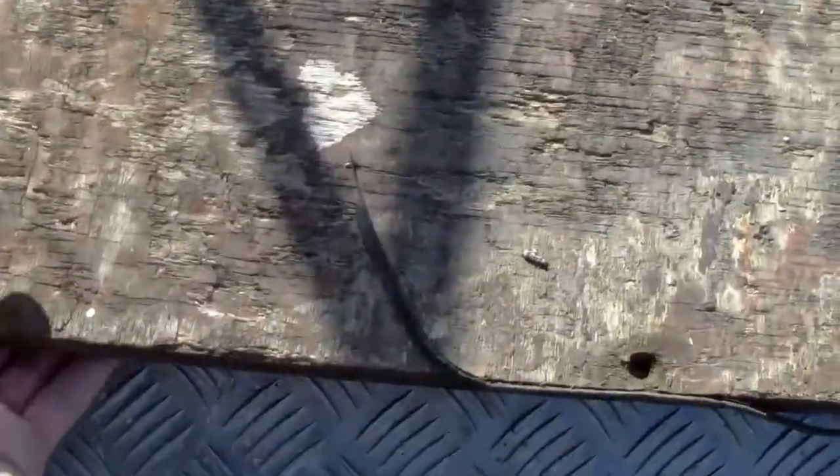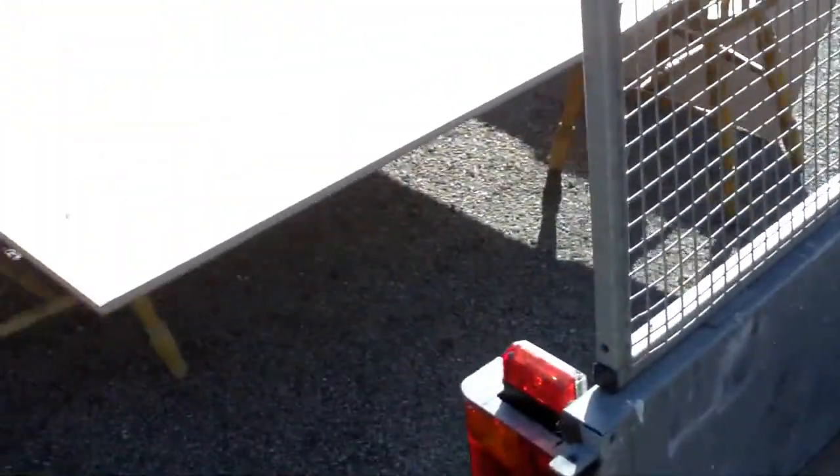I've sawed off a piece and now we've got the shorter piece here which should be six foot by four foot - or 178cm as we measured. I need to make holes in it and I don't really want to have to re-drill into the cross members in the trailer floor. So what I'm going to try and do is utilise the holes that are in the existing piece - although some might be slightly large - to mark through onto the new piece the fixing positions, and then I won't have to drill through the metal frame on the chassis of the trailer. Hopefully.